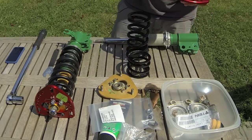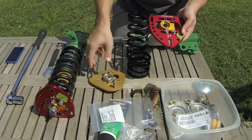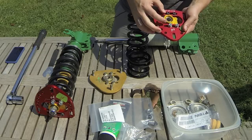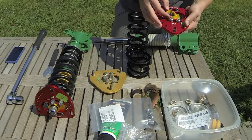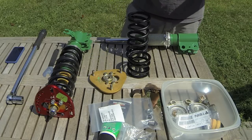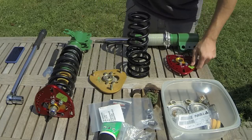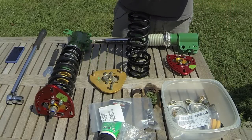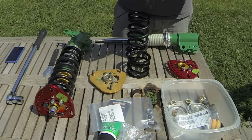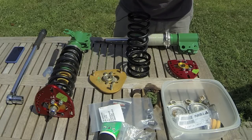The main thing that's different between these is that the Teins are only camber adjustable, and the T3s have these slots built in. They allow for more caster adjustment — actually for any caster adjustment. Also, these are moved back several millimeters to already have a built-in base caster. I haven't gotten measurements yet, but I'd guesstimate at least one degree of additional caster. They also come with these swivel bearings, and what they do is take load off the internal bearing and make it easier to turn — essentially it's a bearing built in there with two plates that swivels and also acts as the top plate.